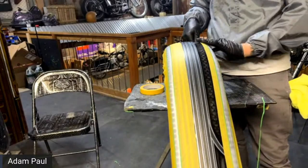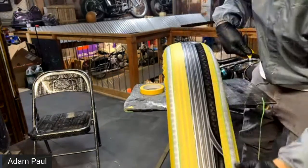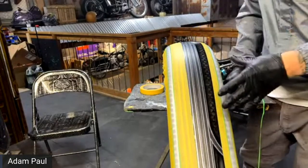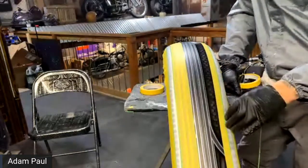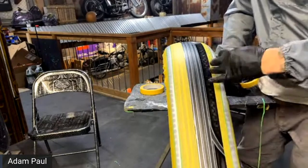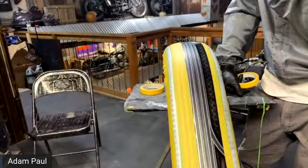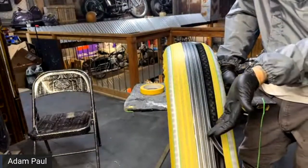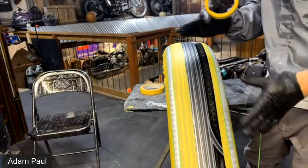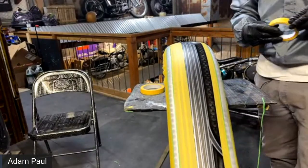You would sand it down and you would probably reflake that area, I'm guessing. I'd have to see it, but there are ways to fix it. The other way would be, where that area is milky, plan out the graphics to put maybe some lace on it. Because lace has the ability to hide problems, like you said, where it's milky or say you burn through. You could design your paint around that disaster and hide it in lace. So maybe try that, depending on how bad it is.